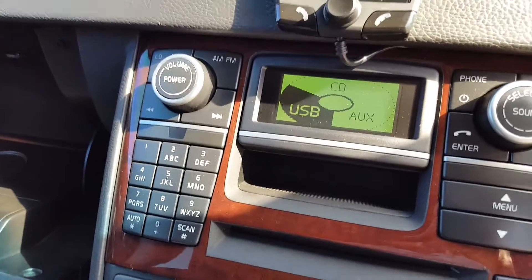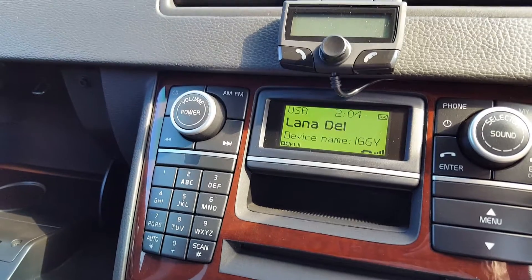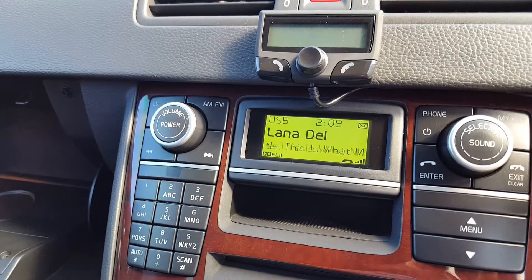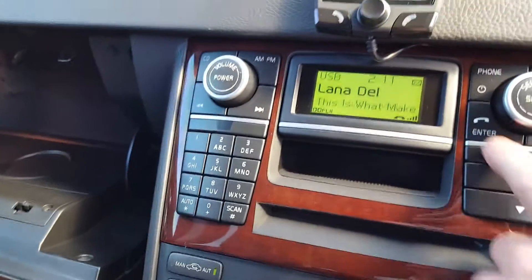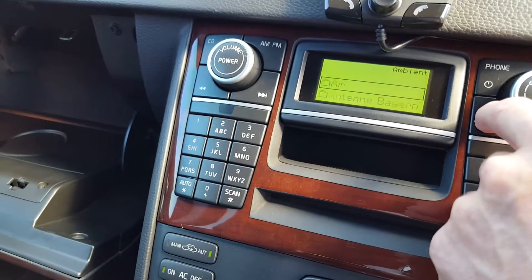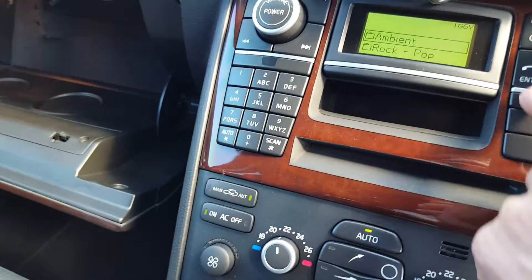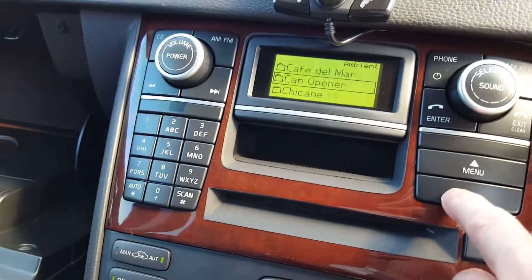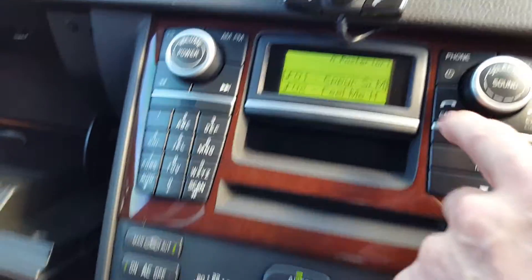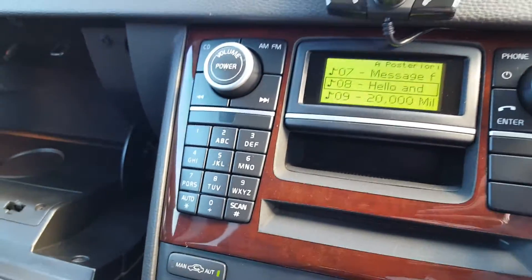You need to use a software utility called Drive Sort to update the order of entries in the file allocation table. Each time you add new tracks you have to run this utility, but when you do, files appear in alphabetical order so you can scroll up and down without any problem and tracks are in the right order — it all makes sense.